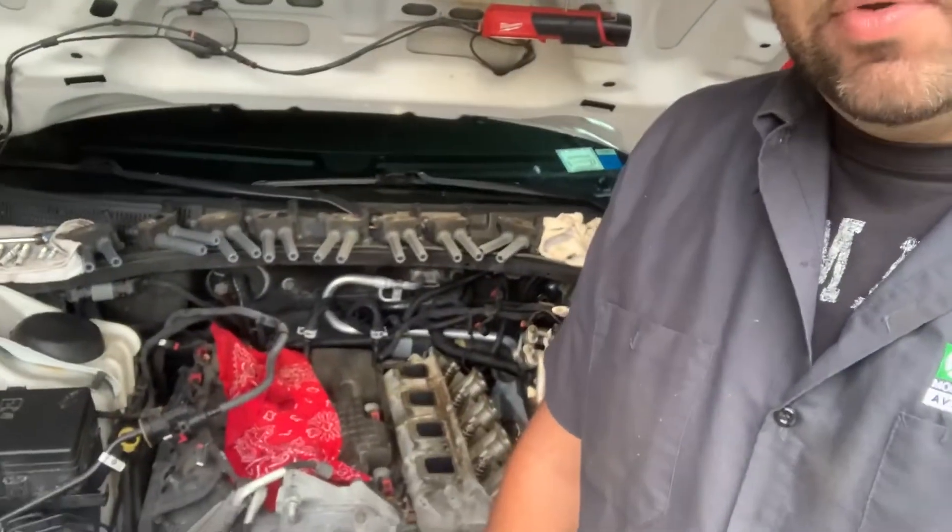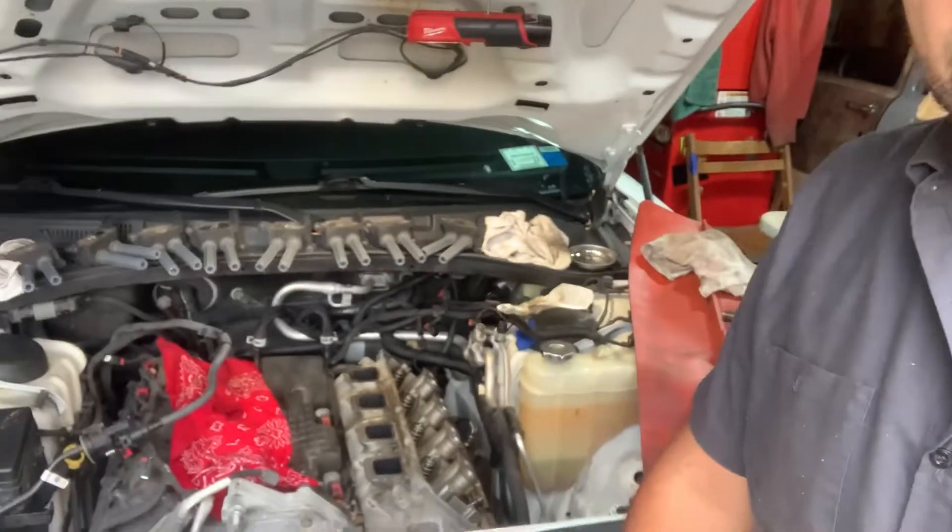What's up YouTube? Right here I'm working on a 2016 Dodge Charger 5.7 motor. I got it all disassembled because one of my camshaft lobes or lifters is shot on cylinder number three — it's giving me a misfire and multiple misfires.